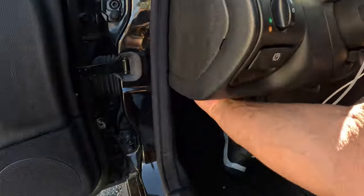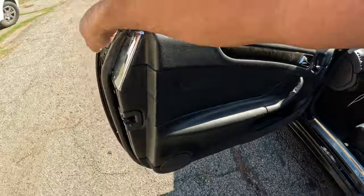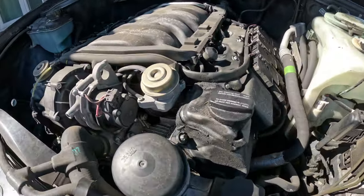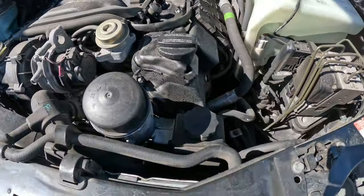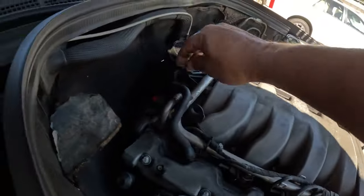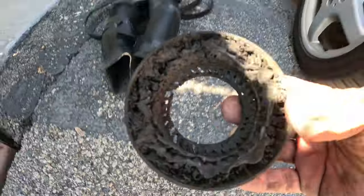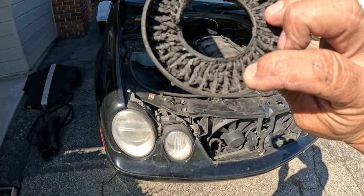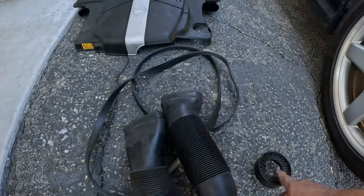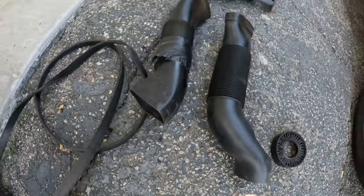Let's open the hood again. The engine needs to be cleaned up. It doesn't look too bad under here though. It's got coolant, got oil. The dipstick — yeah, there's probably nothing there. This is what broke — the adjuster pulley. It's down there in that area. Here's the belt — still intact. I'll probably use it just to test drive it. And here are the snorkels for the air intake, and the engine cover.